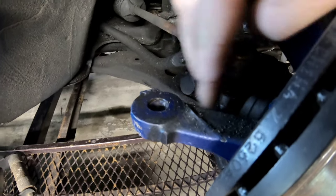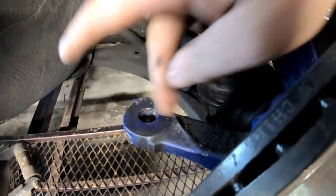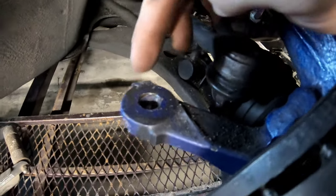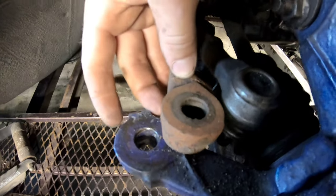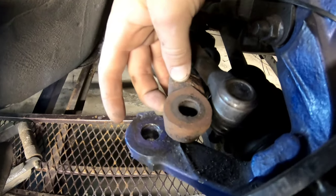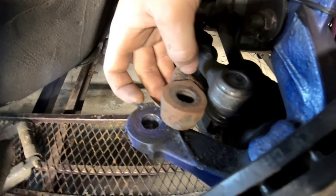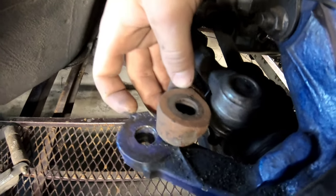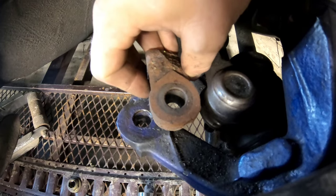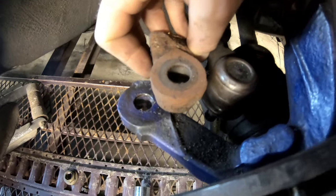What most people do is cut this piece and shorten it so it's closer to the center — but if you cut and move it, you lose the factory position. So what I'm going to do instead is add another hole that is exactly 11/16ths from the original one in a perfect line. So when I move the tie rod from the stock hole to the new hole, the wheels are still straight, but at full lock there's way more angle lock-to-lock.